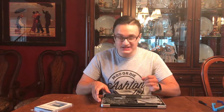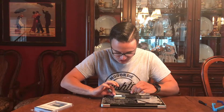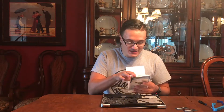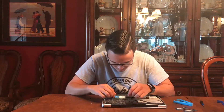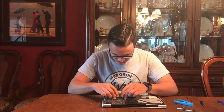Now that we have the battery out, we're going to take our RAM sticks out. There are two retaining bars right over here — you pull them out and the stick should just pop right out, just like so. Now we open our new Crucial RAM. We're upgrading from two gigabytes of RAM across two sticks to eight gigabytes of RAM across two sticks. That should be a good upgrade and it should solve the problem of the computer being really slow. Now popping my second one in like so.